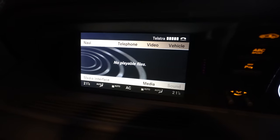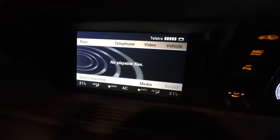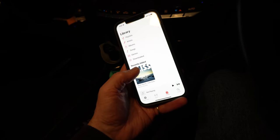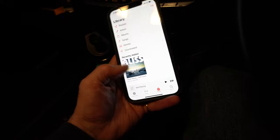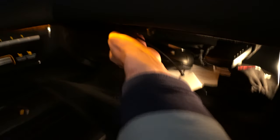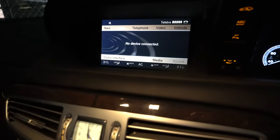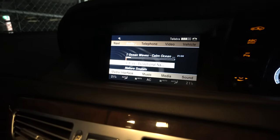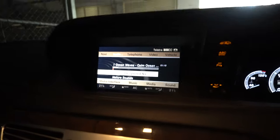That is because the head unit is expecting to see an iPod connected to the interface. And if you don't have any songs in your Apple Music app on your phone, you won't get any playable files — it won't connect and you won't be able to stream audio. You need to have one song in your Apple Music app. So if you download just one song, even if you don't use Apple Music — I had to do this, so I downloaded one of these nature songs — then unplug the Bovee, connect it back in again, wait for it to sync and connect with your device. And once you've got that single song in there, once you've got that one song playing through Apple Music...